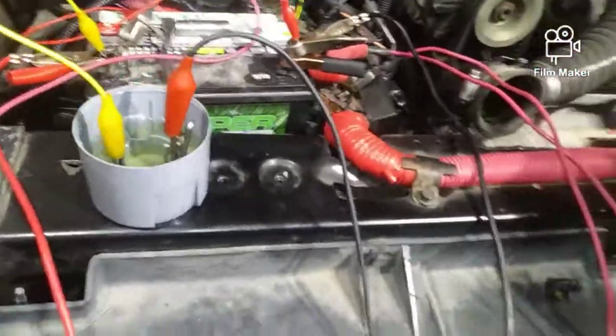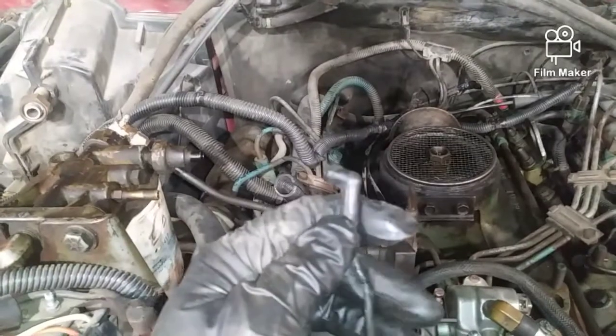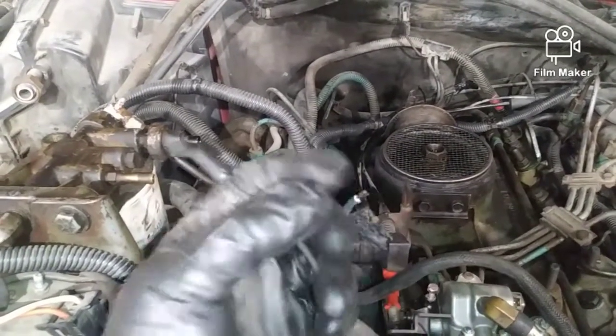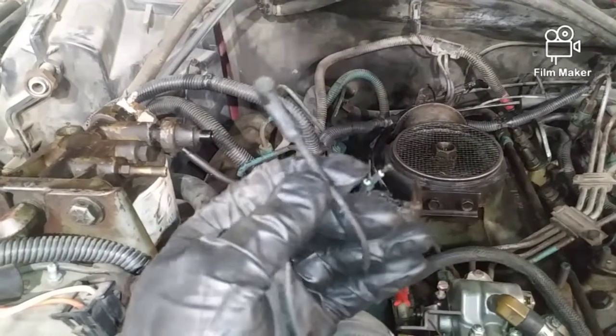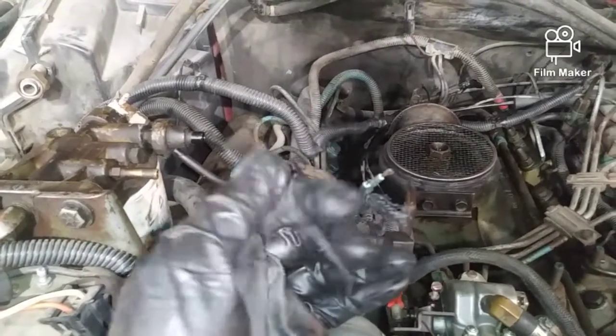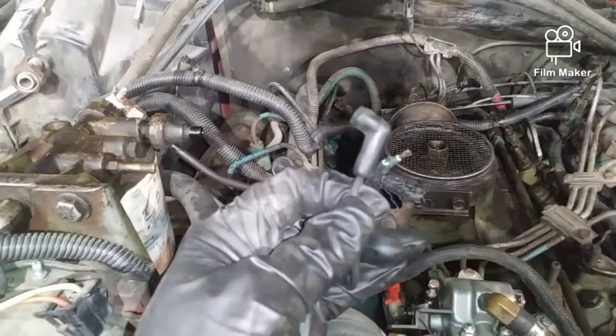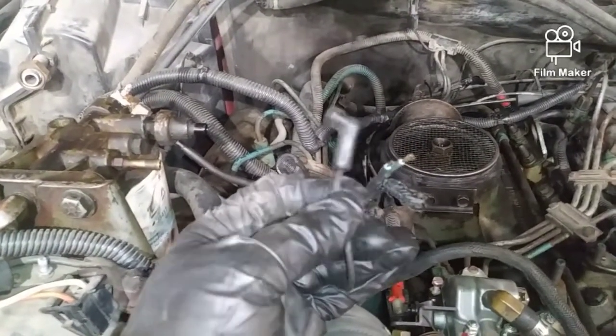Which takes me back to this wire that appears black. Again, it looks like that. There's your water sensor. And water is actually conductive, especially if there's impurities in it. And if I had to guess, I could not find a good accurate print. I kept getting cross references with Power Stroke. This is not Power Stroke, this is IDI.